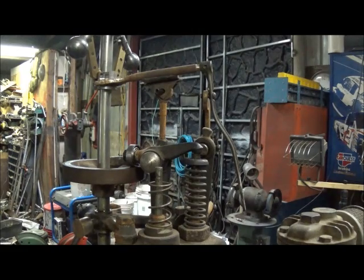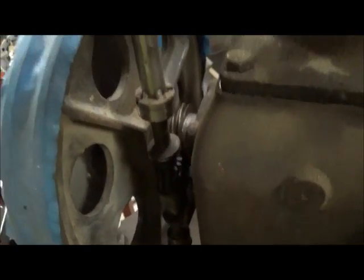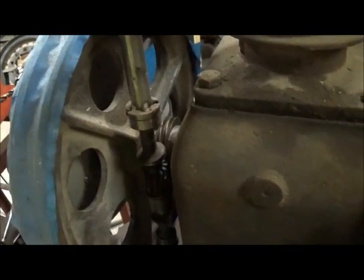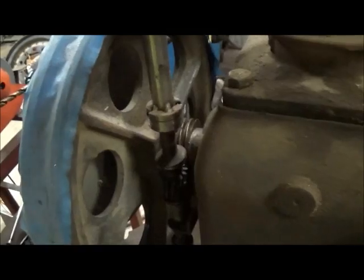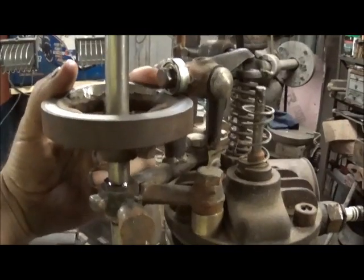They're all set up in different ways, but all of them work the same. I want to show you the gears I'm using on this one - these are actually Volkswagen Beetle gears. I've extended this crankshaft. One of the flywheels is actually off of the bike engine that I built, the four-stroke engine. I've got a degree wheel on it - I was measuring the distance that the exhaust valve was open, which is why I've got it on the wrong side. I just needed the degrees.